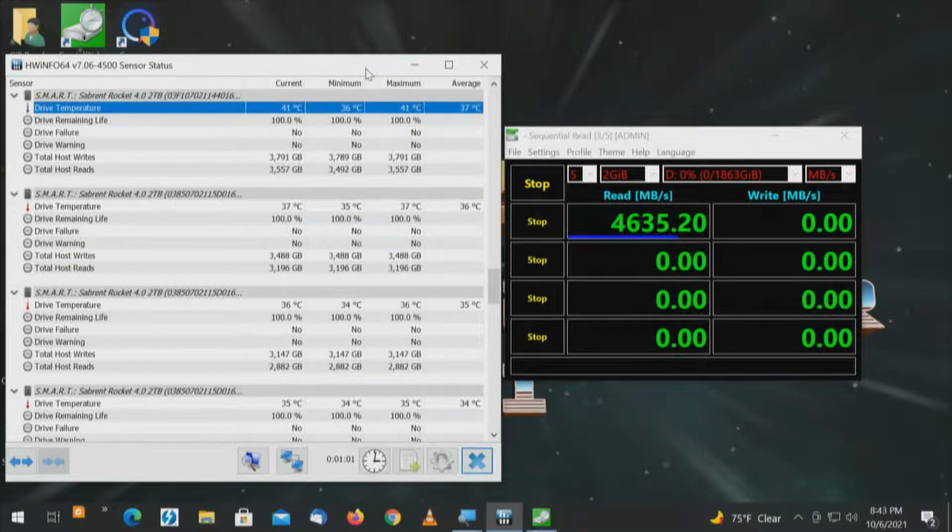Now, while we're waiting on this to assimilate this information, we have a new chart update, and to the existing chart, I've added another chart on the right for the Asus HyperQuad x16, and then below that, we'll add another chart for this card, which is a Gigabyte Aorus x16 quad card. On a side note, I will mention, even though we're doing this as a standard test of what we've been doing, and the goal, of course, is to flush the cache, if we increase the size of that cache file from 2 gigabytes to, say, 4 gigabytes, we would get a better number on the reads than we are right now. But for consistency, we're going to keep this where it's at.